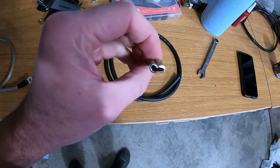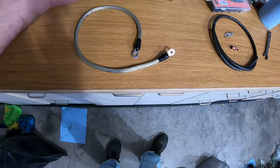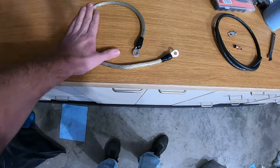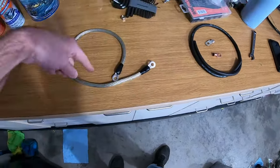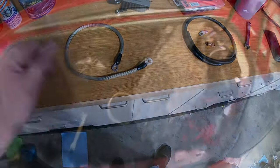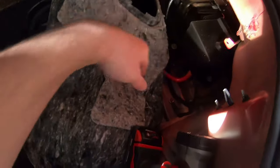When I was looking for another cable lug I found one that was already a bit crushed — I could use it, but when I was going through my old stereo stuff I found this ground cable that's probably the right length and already has all the ends on it. I'm just going to reuse this one since it's four gauge, same as the factory cable. Might as well use what's already done. I'll open the trunk, pull back the panels, and see how this lays in. You just pop off this panel — there are two Christmas tree clips — and then you can get at the battery a little better.